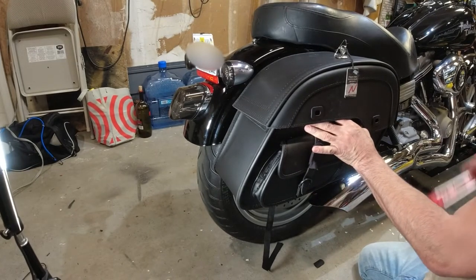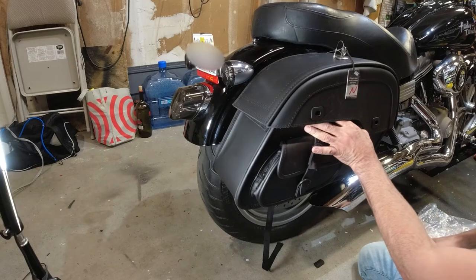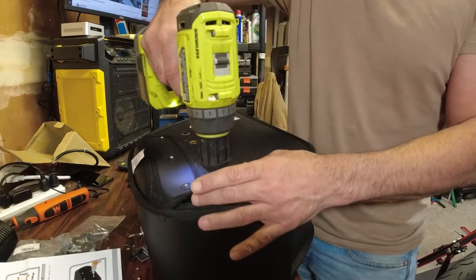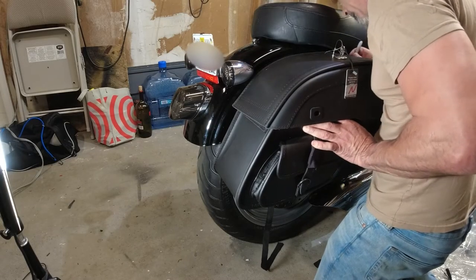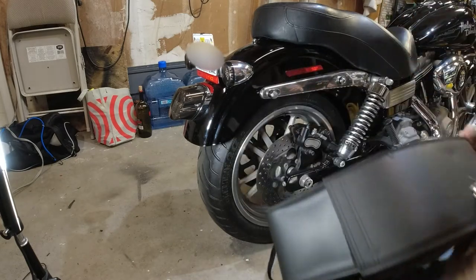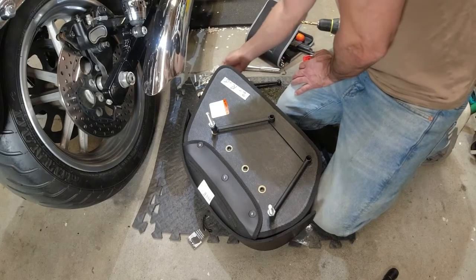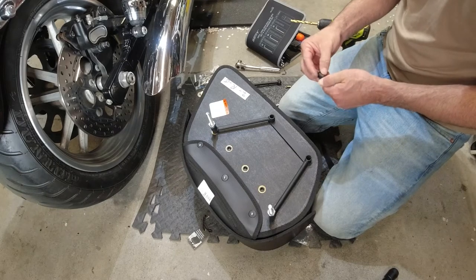If you want bags that bolt straight into stock positions, you'll have to spend five, six, or seven hundred dollars on Harley bags from the dealer. With these, you do have to do some work — you have to fit them yourself and drill your own holes. They give you four pre-drilled holes in the back but they may not line up; I only had to drill one additional hole. Position the bag correctly — make sure it clears your lights, exhaust, seat, and still opens properly. Once it's exactly where you want it, mark with a Sharpie where it meets the fender bolts, and those are your drill points. Hold the bag up against the bike and confirm the holes line up with the fender bolts before moving to the next step.